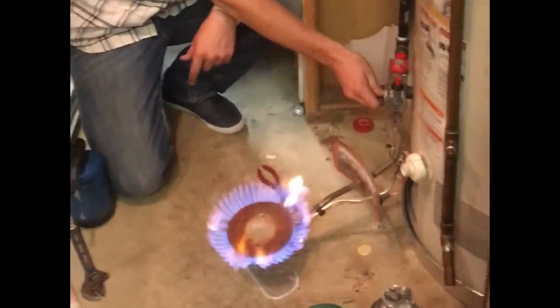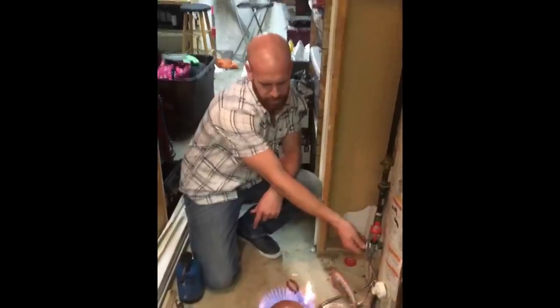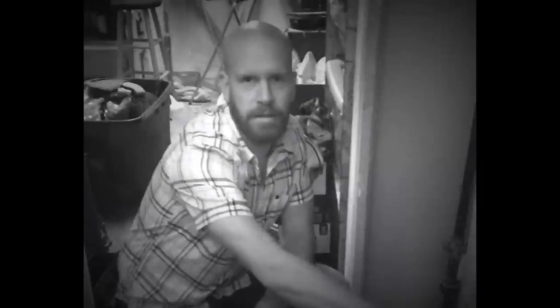But if I take this and put it in there, the pilot won't even ignite. It's insanity. If you're like me — I changed the thermocouple, I changed the gas line, I changed the striker — just nothing would light on the inside. So I took it out and turned it around so I could check it in the open air and make sure it lit, and it does light. Works fine.